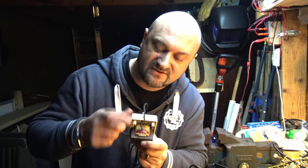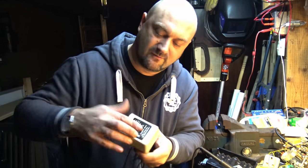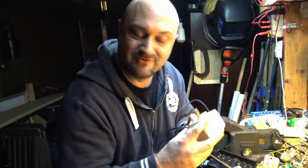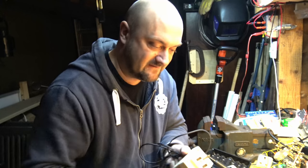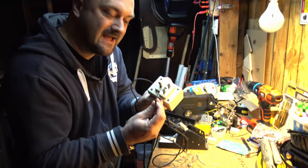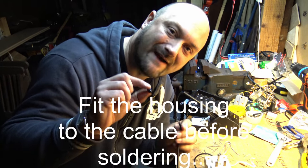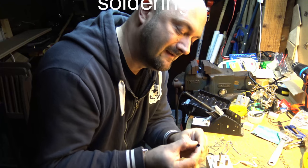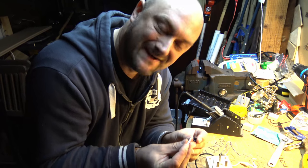What we've done is we put a little knot in the cable and we've soldered the cable onto the appropriate terminals of the transformer. We'll pop the cover back on, screw it all up, plug it into the wall and we'll see if we've got 19 volts AC coming out of it. Now we also have to solder a DC barrel jack onto the end. Top tip people: don't forget to put the DC barrel jack on the cable before soldering it all up, otherwise you're going to end up doing this job twice.